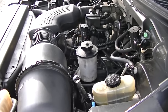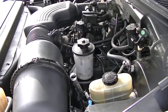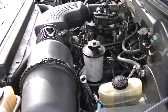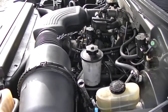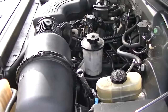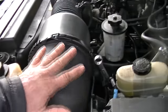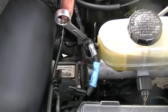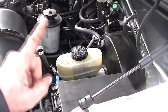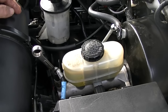I've had a lot of people ask me how to get this ABS pump off. I didn't make a video earlier when I changed it, but I should have, so I'll go ahead and show you guys how it comes off. It's pretty easy if you have just some simple mechanical tools. For my Expedition, I've got this huge air cleaner here — I just moved it out of the way and it gave me a lot more room to get down into that ABS pump. The other option is you can take off your master cylinder, which will give you a lot more room to work with.